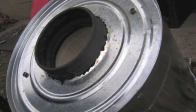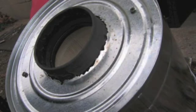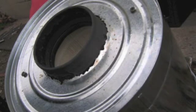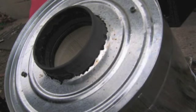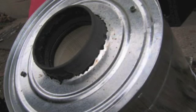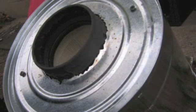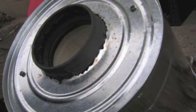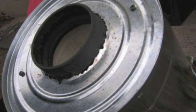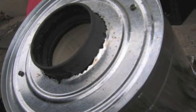On my truck, some of the fender has been cut out of the way to get the battery up front where it normally is on the Dodge, so this makes an issue with splashing. I didn't want to get my filter all wet, so what I did was go out and buy just a metal bucket. We cut a hole in the bottom and screwed the filter in as you can see in the photo, and this works really well in protecting the filter.